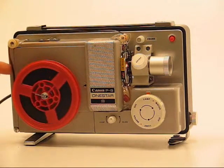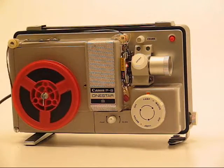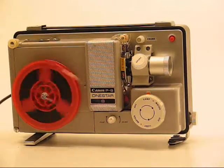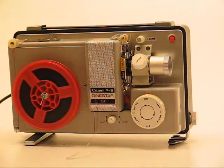I've got the notch cut in the film and it's going to hit the automatic rewind. When that happens, it's going to kick in and rewind the film all by itself — you would do that towards the end of the film. There it goes. Then you can turn it to off. And that pretty much covers all the basic features.